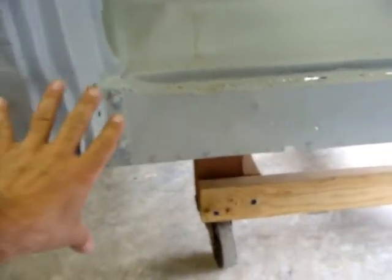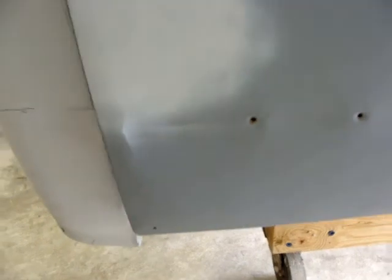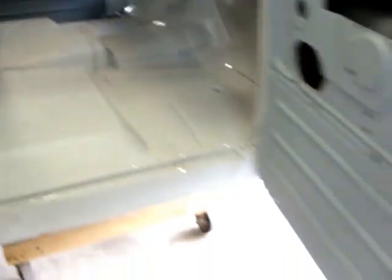I'll probably start on the rockers first. I'll do the inner rocker first — cut this out and put new rockers in first to get them lined up with the door. I'll keep my door on it to get everything lined up. Put a fender out here on the front end to make sure everything lines up on the rockers and the doors. Then I'll come back through and cut the bottom of this door out and start patching that in. A few other small things, and of course body work after that.